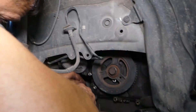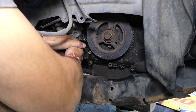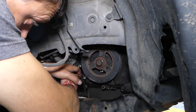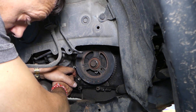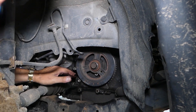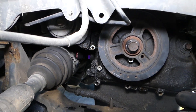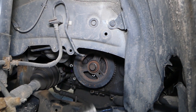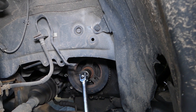All the tools and parts that we use in our videos will be listed in the description below, so please check it out. We got this pin tight — all the way in — we didn't even need to use a wrench. Make sure it's all the way in. Now get a 21 millimeter socket — a 13/16 standard socket works as well — and turn the crankshaft until we contact that top dead center pin.